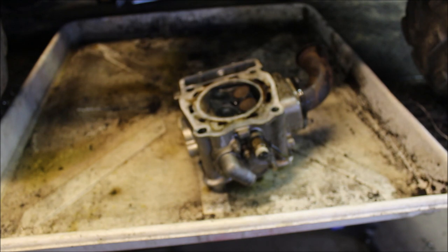So like I was saying before, if you buy a piston kit online, I wasn't really knocking the piston, but the gaskets that come with it, the head gasket, they're usually junk. You can go ahead and buy the whole kit if you want, but just go out and buy yourself a Polaris head gasket, a good one. Because otherwise, this is what's going to happen.